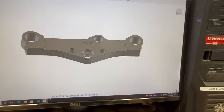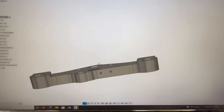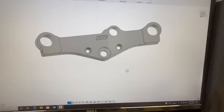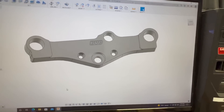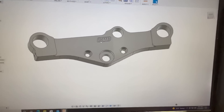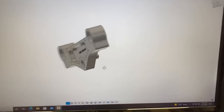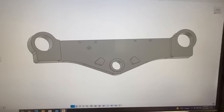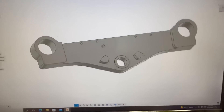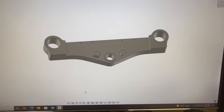I'm going to flip this around so you guys can kind of see what I've been working on. This is legitimately the widest clamp I've ever made — quite a bit wider than what we're used to — and it's because we're getting around that wide tire, so it's just what it is. We had to come up with some new fixturing. As you guys know, we have the fourth axis now, so we've been speeding up making our clamps, but it takes a little while to get everything drawn up. The bottom clamp has the steering stops built in and extra mounts to attach a rack.